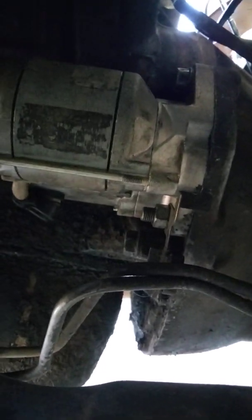Now when you slide this thing across this bottom bolt, it should slide all the way in. 0 clearance between those, should be tight. And then you can hand screw those things in there, and then you want to get your torque wrench and put a little torque on there after, but should be flush when you finish before you even put the bolts and nut on.